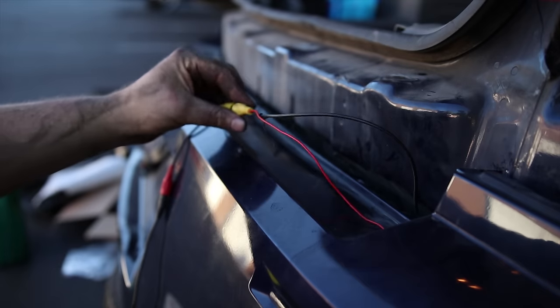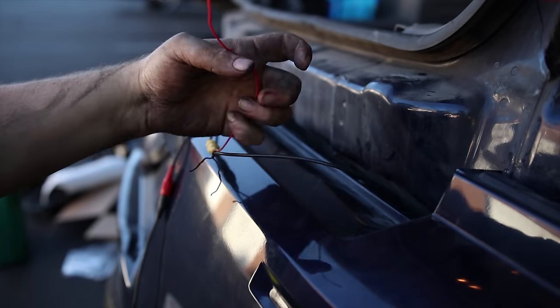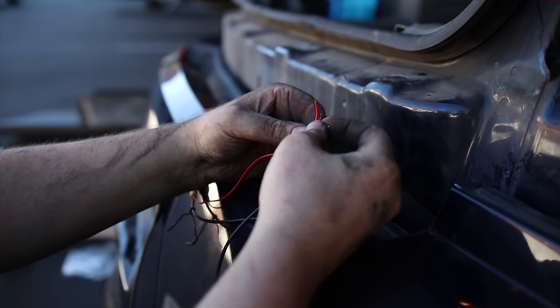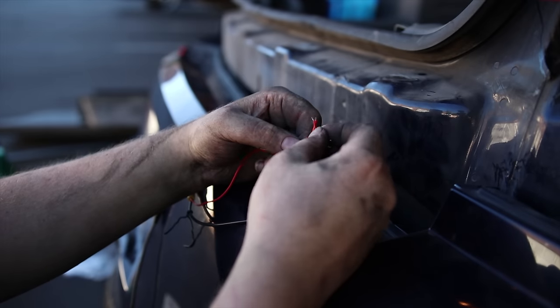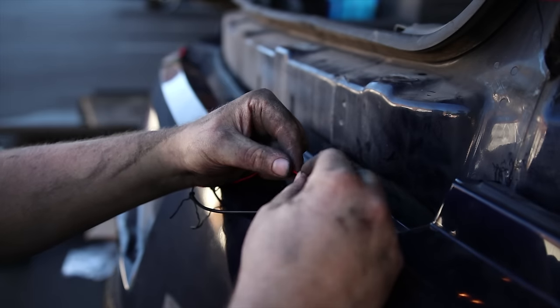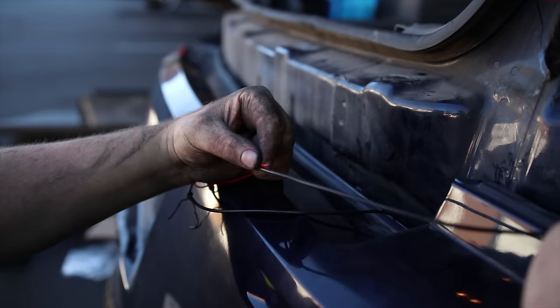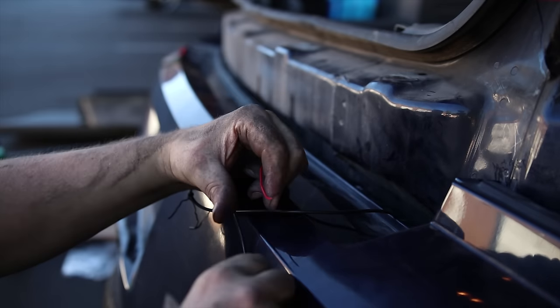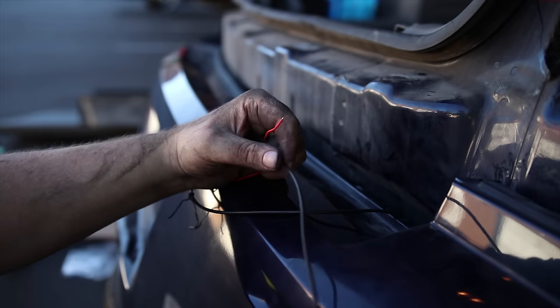So this wire that goes off the video, I need to join that with this power. Run that up to the reverse light. So I can either join it here, I guess it'd be right around here, and either T-tap it here and then run this up to the reverse light, or extend this and then join them both together in the T-tap.